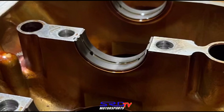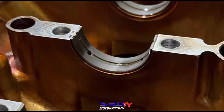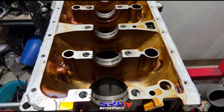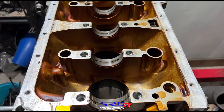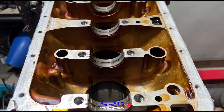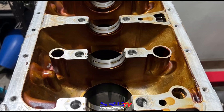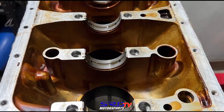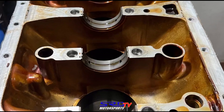Personally, for the K24, I find the drop-in cams a little too small. If you're worried about idle, the tuner can handle that. If you're worried about low-end torque, it's a K24 — the displacement is already strong, more than enough for a Civic. It's like building a B-series with a stroker crank — 95mm or 97mm stroke — and then putting in Pro 1 cams because you want low end, when the displacement already gives you that.